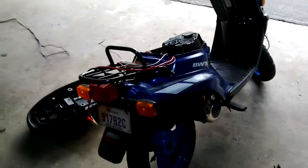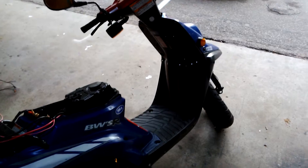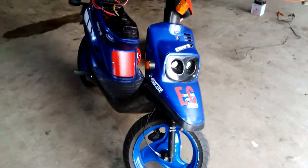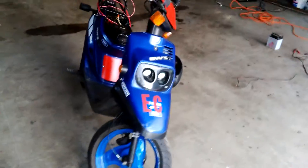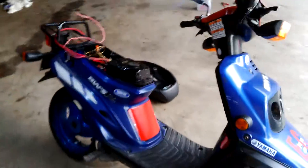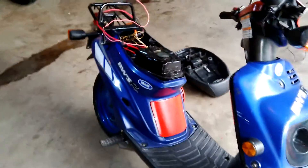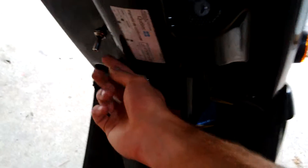With the 36 volt, I was able to go at 92 kilometers per hour. And with the 24 volt battery, I'm now able to go at 70 kilometers per hour. But the 92 kilometers per hour was a little bit too fast because the original scooter can go at 80 kilometers per hour. That was hard because the lights start when you start the engine, and now there is no more engine. So I simply connect the two lights with the switch directly connected to the battery.